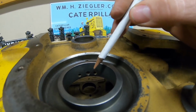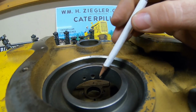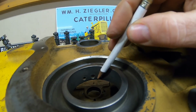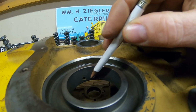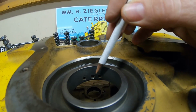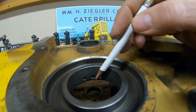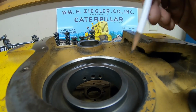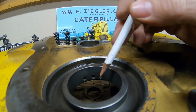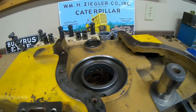Looking once again at how we had to cut those steps, this front main really illustrates how little room we have to work with, because we had to halt at 3/32 in, because any more we'd start getting into that larger 3/8 diameter step land that's up at the top of this center dowel hole right here, and we didn't want to do that. So yeah, 3/32 out for a cut, and then 3/32 depth. That's really about all you can afford right there. That still gives us an 1/8 inch wide flange on our bearing to have a little bit sticking out past. So I believe that's going to be sufficient.